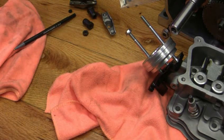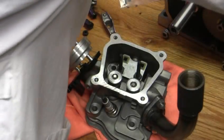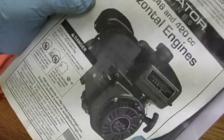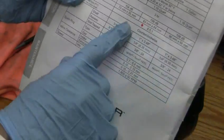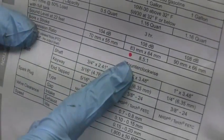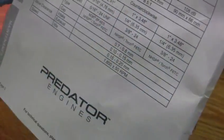What we did was we were looking at these directions here. By the way, you want to look at this - this is your Harbor Freight catalog-grade catalog. Go to page 2 and you'll see the compression ratio is 8.5 to 1. You could increase that up to 10 to 1 and you'll still be alright with the crappy gas we've got in America.